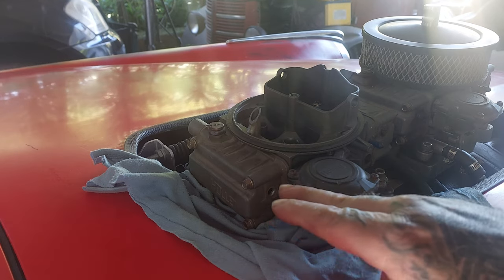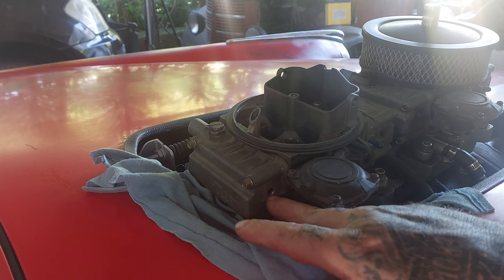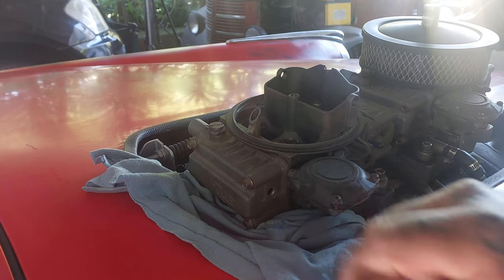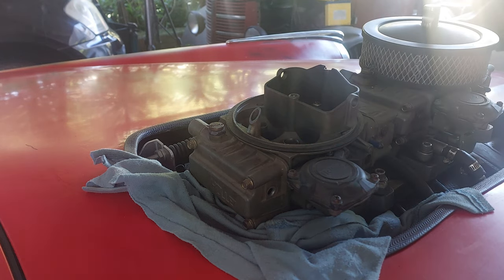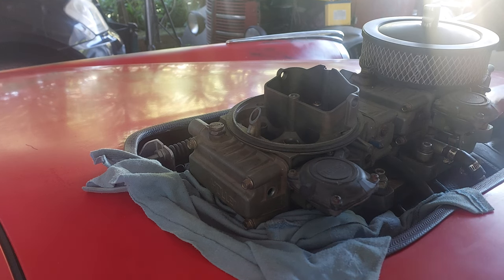Yesterday I took this out and turned the pump on, and as you can see, without the pump nothing's running out, but when the pump's on, it was coming out. So this rear float was way out. Now I've just taken a quarter turn out of the nut, we're about to turn the pump on and see, and we'll adjust this till we get it right. We'll check all the others, and that will be our first port of call.